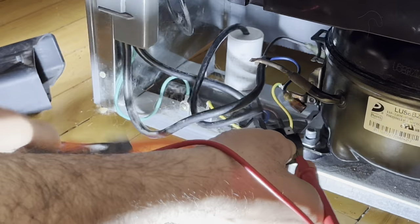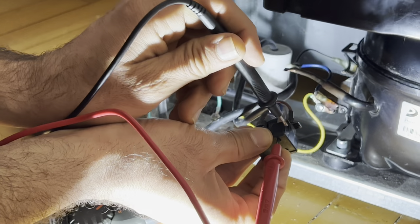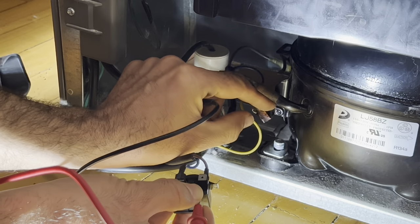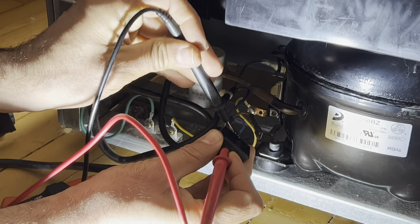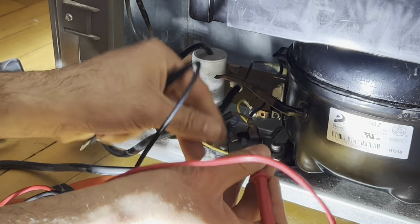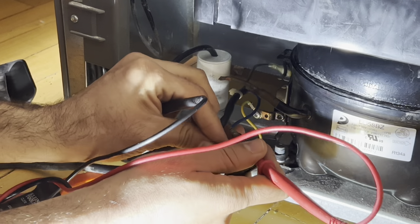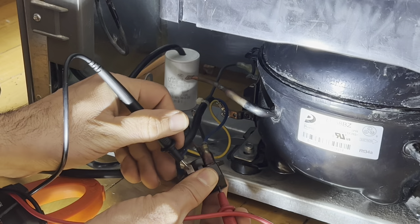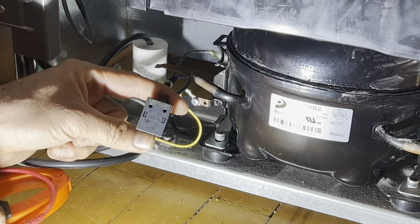You see those two holes — it has two pins at the back. We will disconnect one of these and put our probe inside where that hole is and check it from this side. Select continuity — and to confirm you have continuity selected, touch the two probes together. That confirms it. I got continuity on this one — that's good. I'll check the other one — got continuity. But between this pin and the bottom one, and between the other pin and the bottom one, I have no continuity. I should have continuity on these pins — that tells me we have a bad relay.